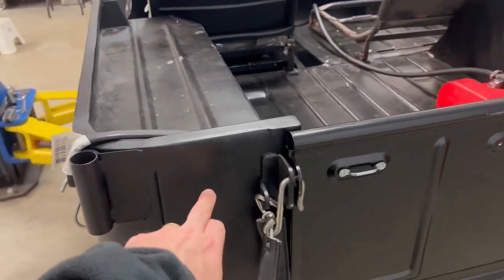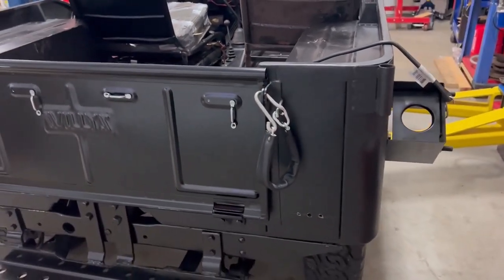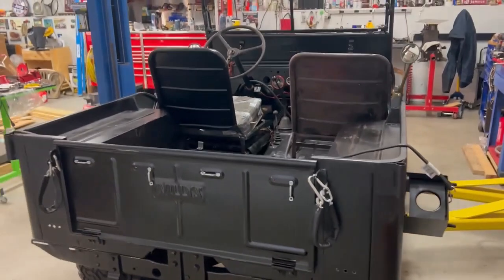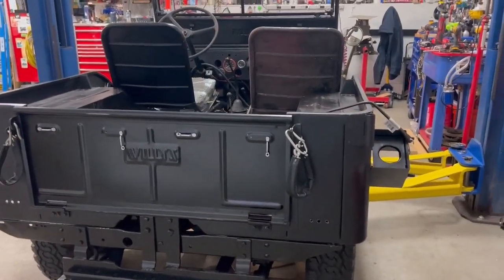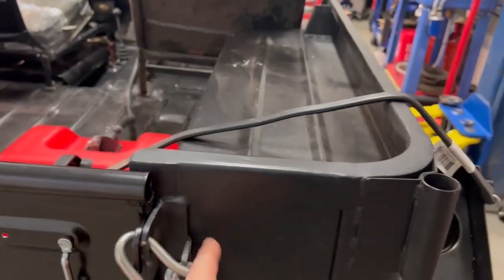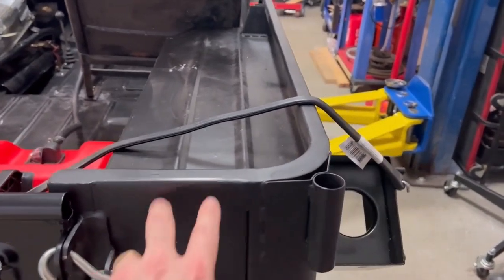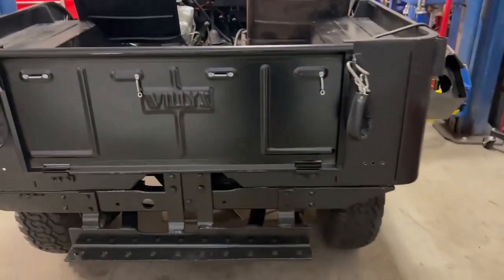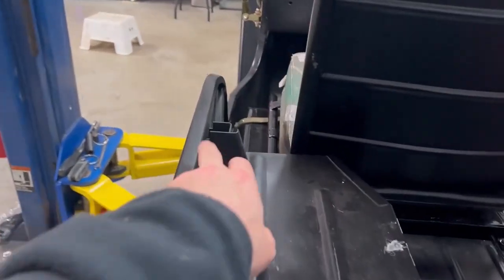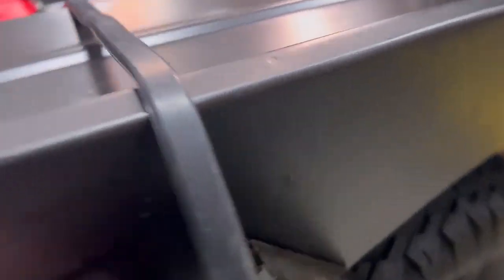There should be a footman loop on each side of the tailgate for the soft top. I've been using a fully original 3A as a template. This is a 2A, so it's a little different — we'll get into one of those key differences later with the seats. Right where the footman loops are supposed to go, there's actually a crease and some spot welds inside, so it wouldn't be easy to install them there. I'm debating mounting them above. I want to drill the holes before I get the body painted. I also had to weld on the soft top mounts on both sides, as they didn't come with it.